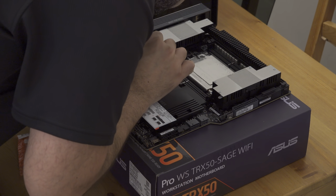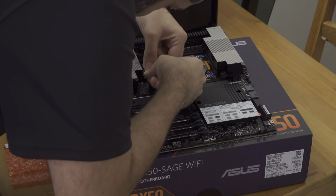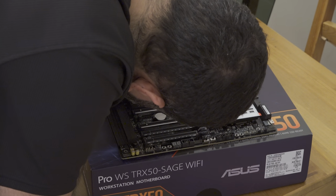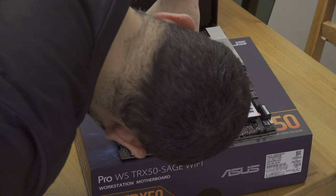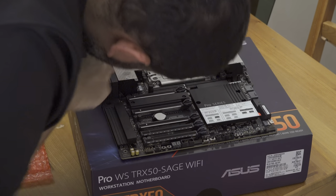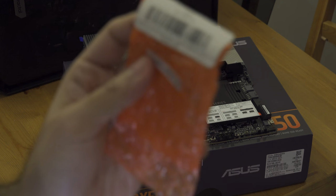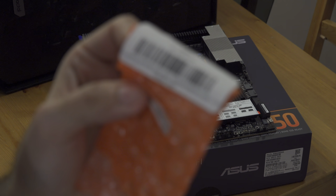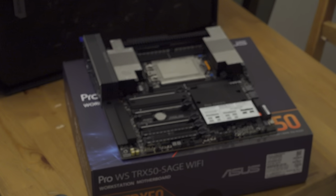The TPM location is tricky — my hands aren't the smallest but I definitely want to mount it before installing RAM. You want to get this done early because of its location. I have to verify the light source. It does say on it — it's just upside down. That's the TPM SPI chip from ASUS — I ordered it separately.